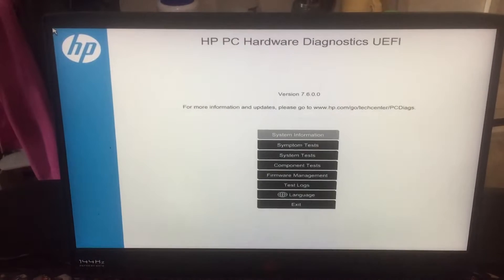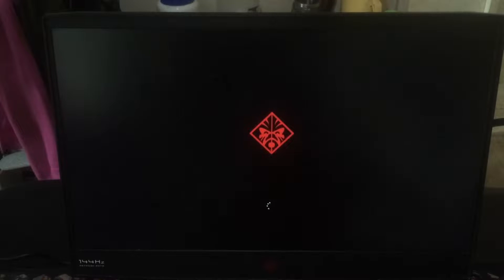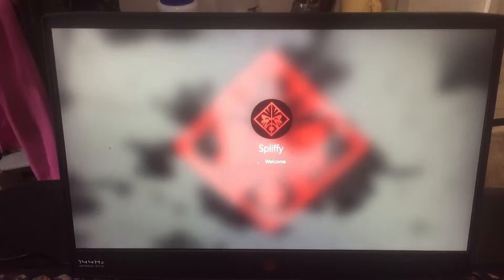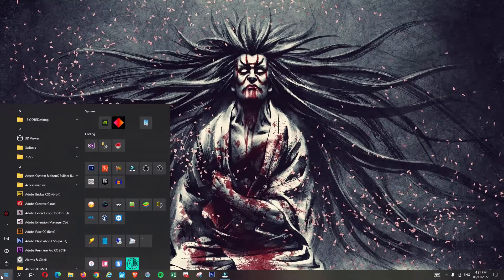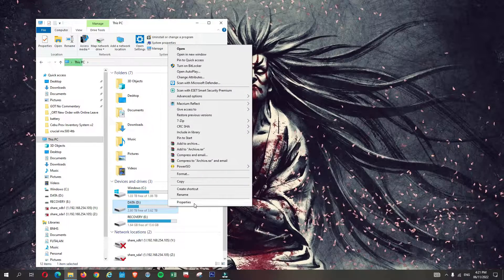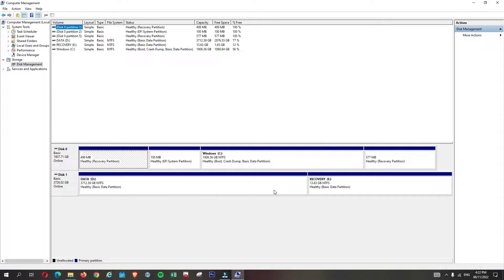Let's check if the drive is detected by pressing F2 or Startup Check. Select System Information, then Storage. Yeah, it's there! No error on Windows boot. I'm not an early Windows 11 adopter, so bear with me. It already shows on This PC, and also on Disk Management. Great!